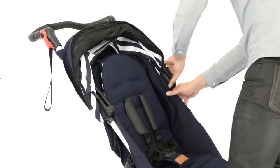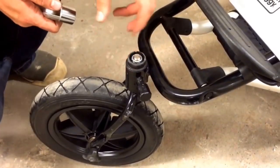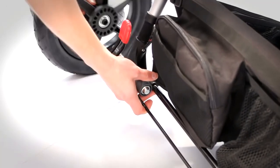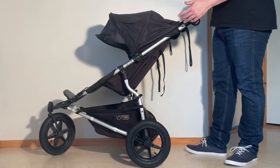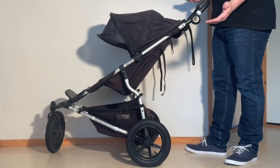Some of these changes were good, like using a nut as opposed to a locking washer in the front end, and some were less good, such as the shift to removable axles on the rear frame, which weakened the model by adding complexity. None of these other changes are deal killers in my opinion, but when hunting for a model, just be aware that there will be some variation in what you need to check on.